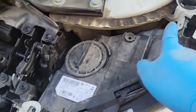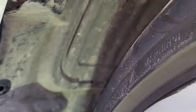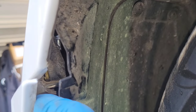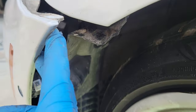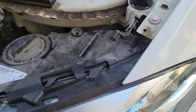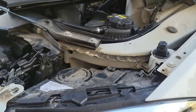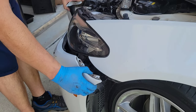One thing I failed to mention: once I was removing these screws, it still wasn't moving. So I went ahead and removed these bolts at the top of the whole disc part — two 8mm bolts there. Once you get those removed, it gives you some leverage to work with the headlight. The headlight should come up somewhat loose now.